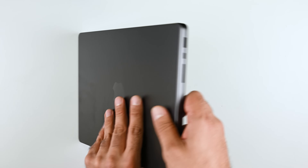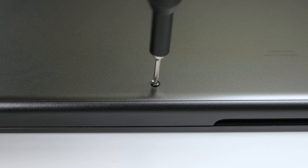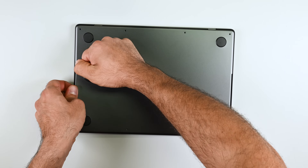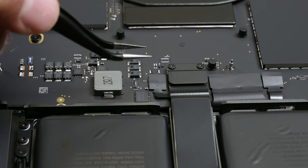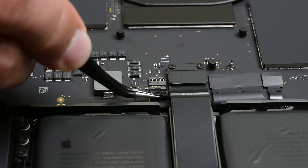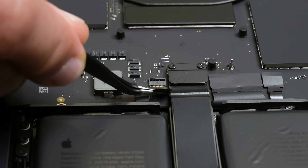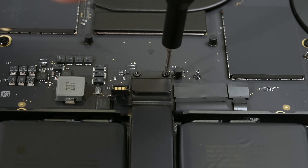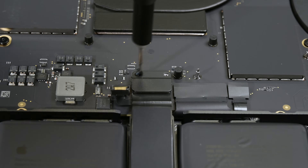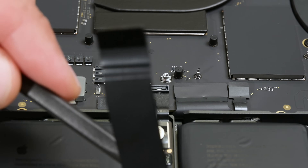The process for opening up the MacBook Pro has barely changed over the past few years — we still have P5 screws securing the bottom cover, and it's still clipped in place. What has changed is Apple's approach to repair. With repair guides available on day one, I can see Apple's recommended approach is to remove the battery management system's cable first, which cuts power to the device even as the battery is connected, preventing any accidental short circuits.